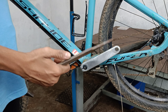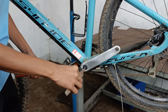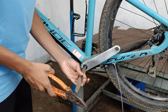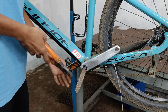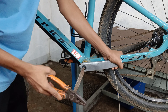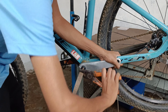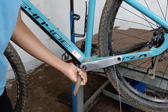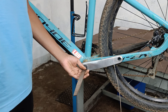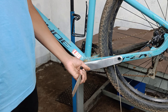Take a file. We're going to use the back end of the file, put it inside the rounded-up hole, and hammer it in. Once it is fixed, take the plier and twist it. We have successfully loosened a rounded-up crank end cap. This hack works 99% of the time, but in some cases it rounds the hole further, so be careful with it.